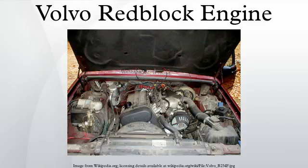LH2.4 Jetronic fuel injection for European markets. FX — same as the FB but with a distributor mounted on the block for use in the 240. FD — essentially a B230F fitted with exhaust gas recirculation and pulse air system for cleaner emissions. T — turbocharged, used after E or F suffix. FK — low pressure turbo, 1995 onward, not supplied in North America.